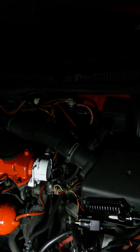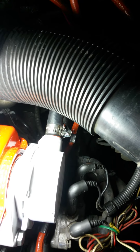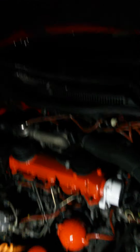Your clamps that come on these vacuum pumps — the stock clamps — are just garbage. They're press clamps, not even spring clamps, and they don't maintain tension on the line, so the line will leak. Cut those clamps off and get yourself a real clamp on those lines and you should be good to go. Hopefully that helps some people out with the vacuum pump. Take care.